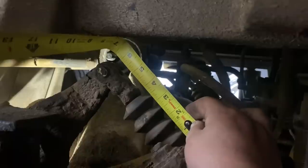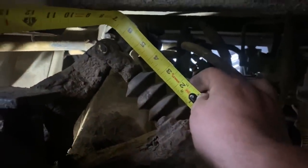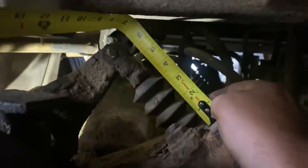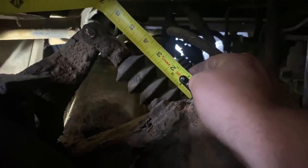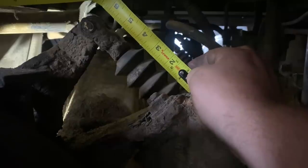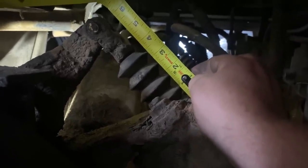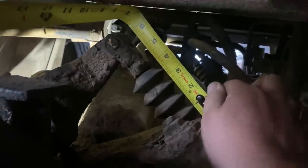We're gonna remove his brake drums. Before they do that, I want to know what his parking brake adjustment was at. So we're right at about 6 inches from the faceplate to the clevis, and we'll see what it goes down to when we release it. Hopefully it's more than 4 inches though. If it's properly adjusted, we're about 4.25 to 4.5 is what we should see there. And anything below 4, it's way out of adjustment, which they look like they're out really far, so we'll see.